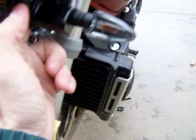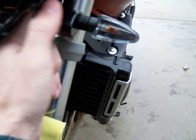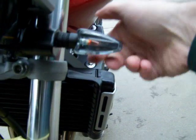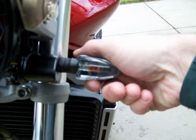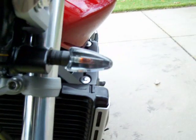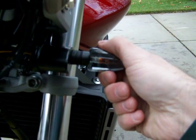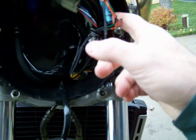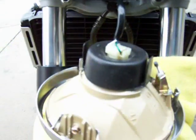Then you're going to tighten the nut up as hard as you can with your fingers or with pliers, whatever you can do. Okay? Then to make it tight enough where it's not going to come off, these are pointing the other way, you're then going to twist them 180 degrees and then they should be snug. Okay, so really the only tool you need is your hands if you use a lock washer. And the rest of it's pretty simple. You do the same thing with the left one, right? And then you tuck it back in the shell, put your light back on, and you're done.